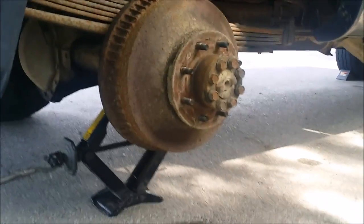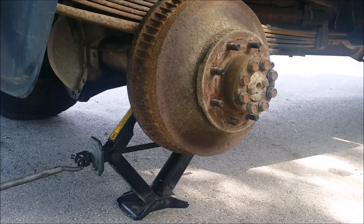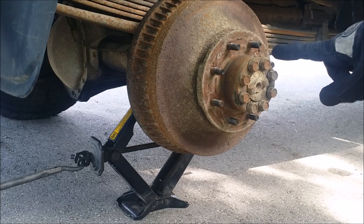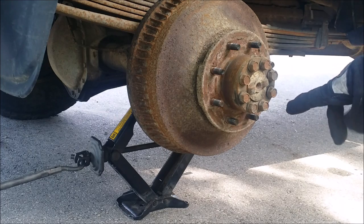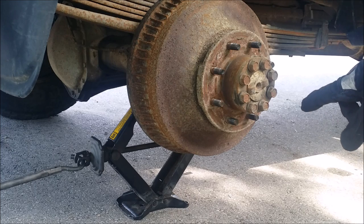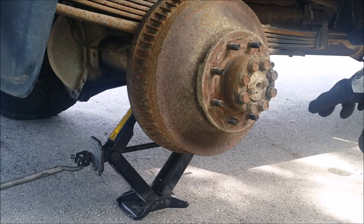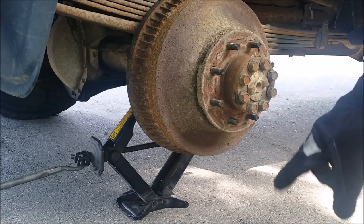Now that the tire is off, next you're going to want to take these bolts out of your axles right here. The drum on these heavy duty trucks does not come off unless you pull the axle out. When you're done, don't forget to refill it with fluid - it's a good idea to just do a quick flush. Have a bucket or something to catch the fluid that drains when you pull the axle out.